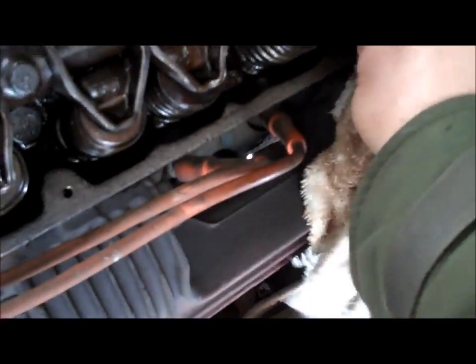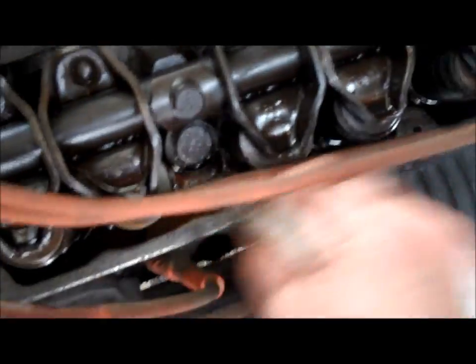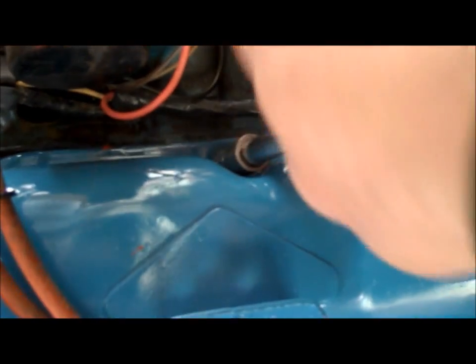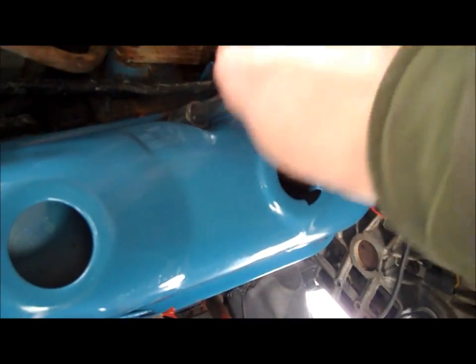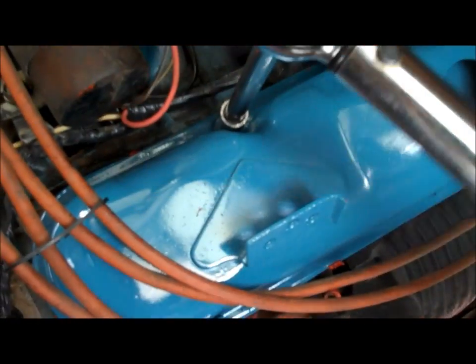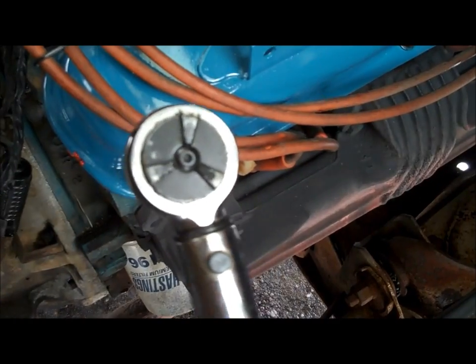Even one last time before you put these valve covers on, take a rag wet down with acetone and clean up those edges. Acetone evaporates very quickly, which is nice for being able to do your work right afterwards. Carefully slip your valve cover in and lay it into place. Put a little pressure on it. Then, starting in the middle and working my way out — the same technique I used with the exhaust manifold — I'll hand-tighten everything, then use my torque wrench to get to 9.5 pounds of torque on each stud. Don't just tighten one bolt at a time; go around spreading it out evenly, doing a turn at a time until that torque wrench clicks.